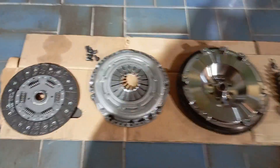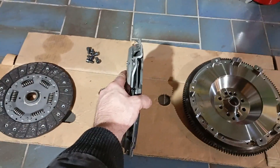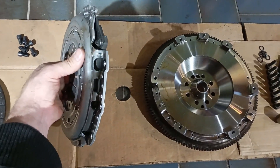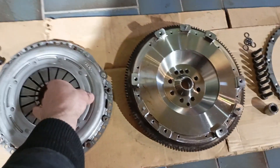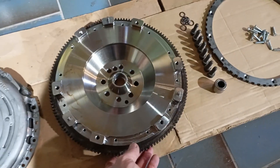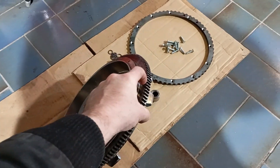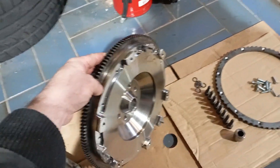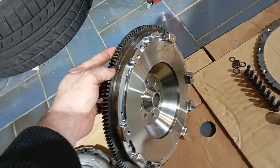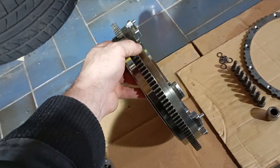This pressure plate has a higher torque transmission capacity and it is also a very flat design, which I like because the 765 is very thick so you have to design a much different flywheel. I wanted to stay close to the original design except for some weight reduction. The starter ring is machined right into the part so it's a single piece, but as you can see it is hardened — it got heat treated so the wear is minimized when you start the engine. I think it is a very nice and very long-lasting part.